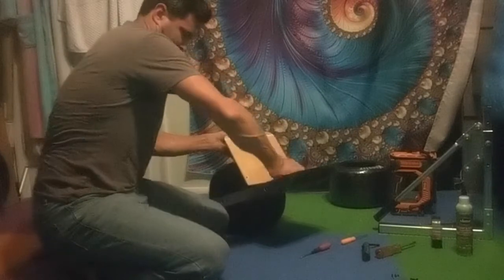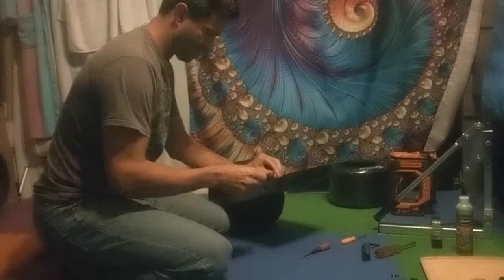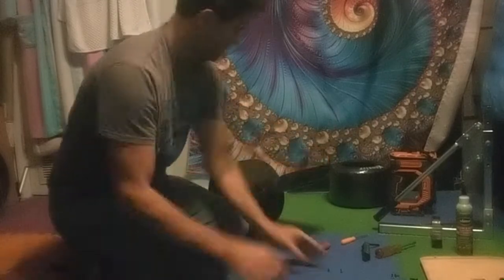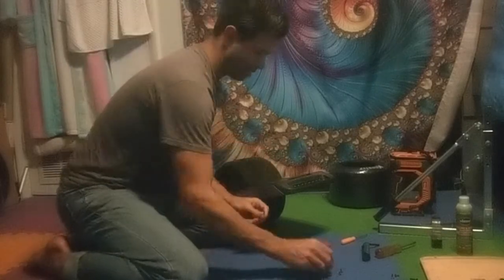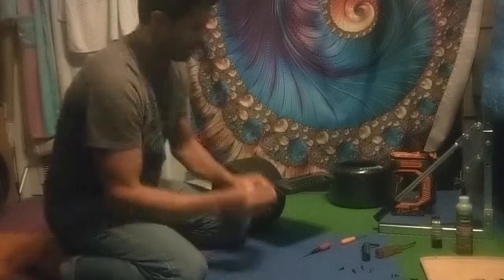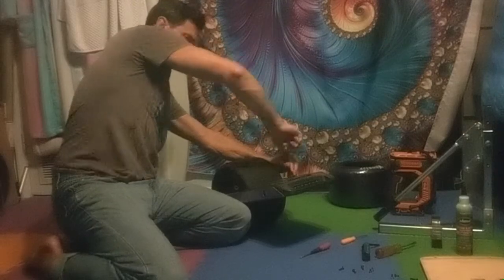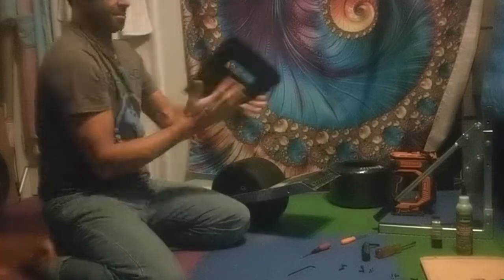Here I am disconnecting the foot pad connector, and off it is. Here is me taking out those two screws that were hidden — they're really small, kind of an inset. They really do suck, so if they give you problems, just force them out. Here's me taking the other couple of screws out on the bottom side of the fender to get the fender out. We take the fender off to get to the panel below that, which houses the electronics.